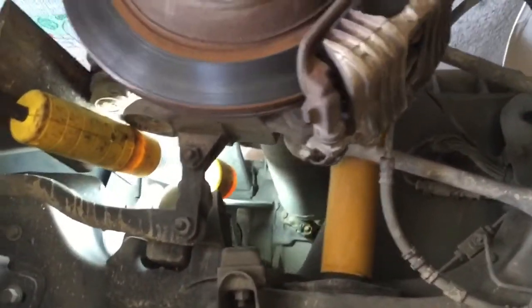The way the rear wheel works on a C4 Corvette for alignment and positioning, it's held in place by what I'd call a three-legged stool. One leg is the tie rod end, the second is the leaf spring which is a somewhat flexible connection, and the third is the lower control arm. Once you push the lower control arm down you can see the whole hub move. The third leg of the stool is the half shaft itself, so to get the half shaft out you've got to create some outward movement and you can actually pull that hub out.